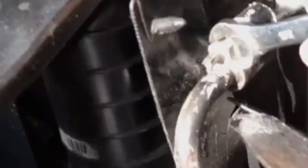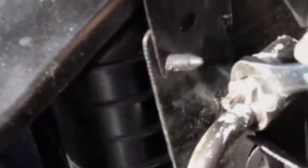So here's what I would do. I would put the vacuum on for 5 minutes and then check for leaks. I mean, turn it off, check for leaks, like wait for about 10 minutes or so, check for leaks. And then after that, if you don't have any leaks, I would turn the vacuum back on for another 25 to 30 minutes. After you finish the vacuum process, you would recharge. I'll record another video on how to recharge the system.